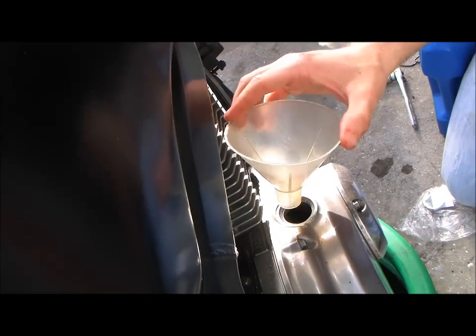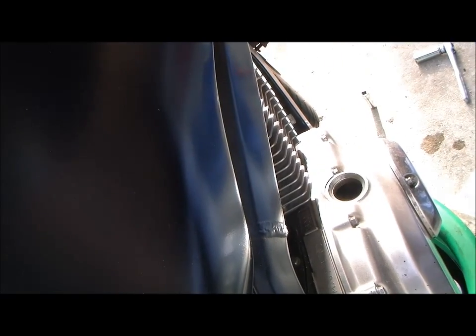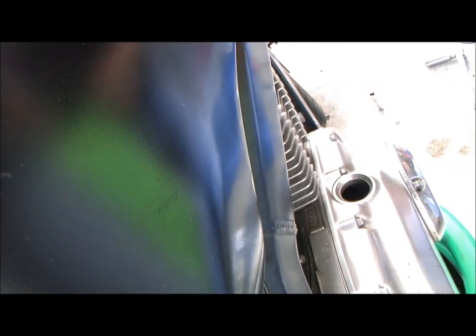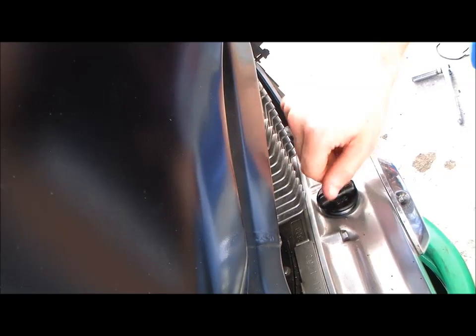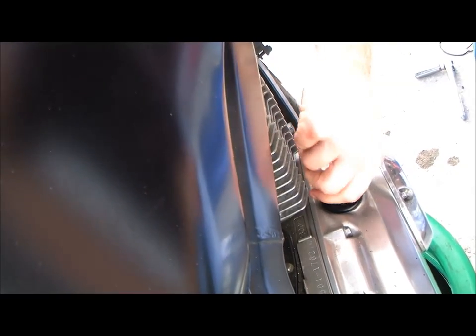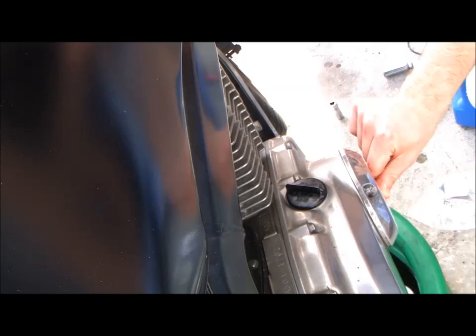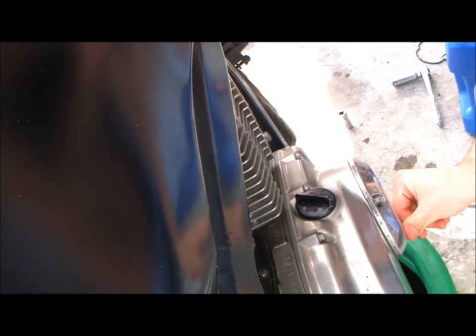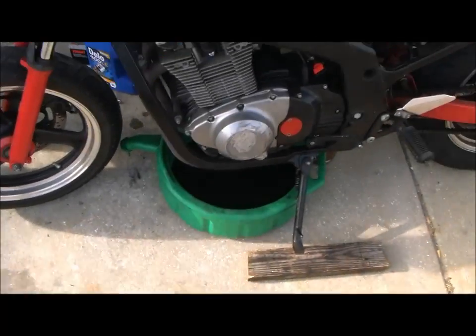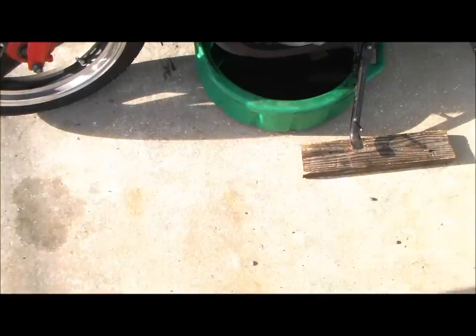These air-cooled engines in Florida, you need that extra weight — use 15W40, don't use the 10W. The recommendation when they put 10W on there is a general recommendation for everywhere. If you look at the books for these bikes in Central and South America, it says 15W40. I'm down to a little under a quarter container. All right, fuckers and fuckettes, now you all know how to change your oil on the GS500 — straight 500. I'm sure it's probably the same for all the other 500s. Yeah, the 450's the same.